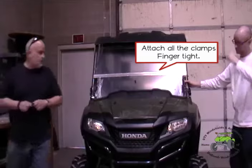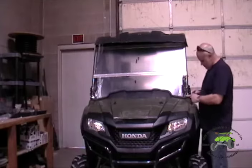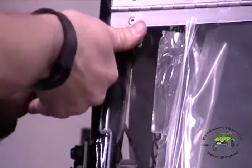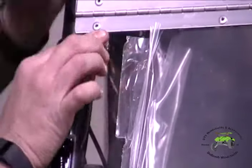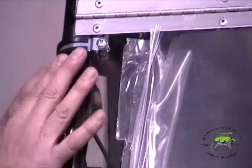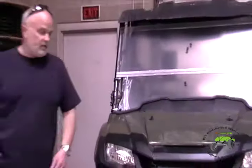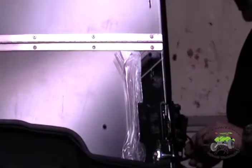Then grab out our other long bolt and come over to the other side. If you have mirrors, you're usually better off moving your mirrors up into the little area between where the slots are. It's a good area to put the mirror. You can take a notch out of the windshield if you need to for setting your mirrors. Polycarbonate isn't like acrylic at all — it won't crack or break when you're cutting it for a mirror.